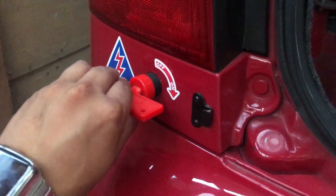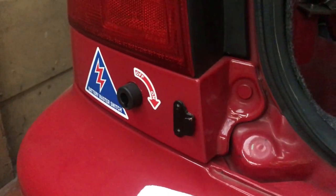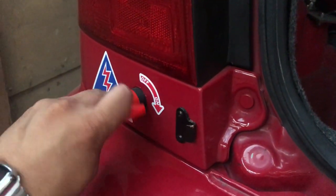And also, the battery cable will basically run through here and go out the other way, and then just run down at the bottom through the mat and then go through the firewall. The reason for the battery also being on this side is because I would like to connect the kill switch as well. So that is something that we'll be doing.